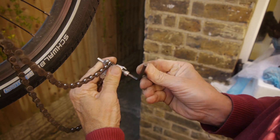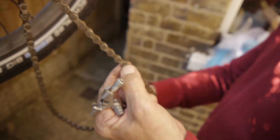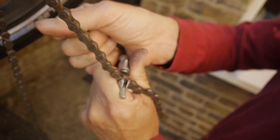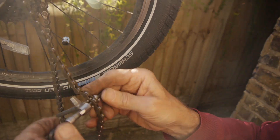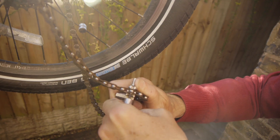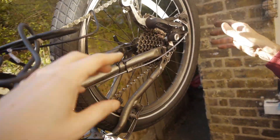Because the original bike had a 52-tooth chain ring and the motor came with a 44-tooth chain ring, we had to remove some chain links. We used the chain link remover and a size 4 Allen key to remove them — eight links were taken off in this case anyway. You might have to use a different number, so you might want to watch another YouTube video to make sure you get that right; you do get to see a quick example of it here in this video.